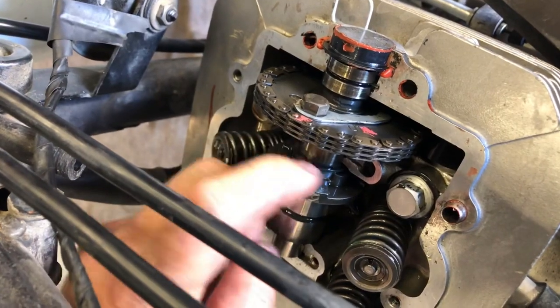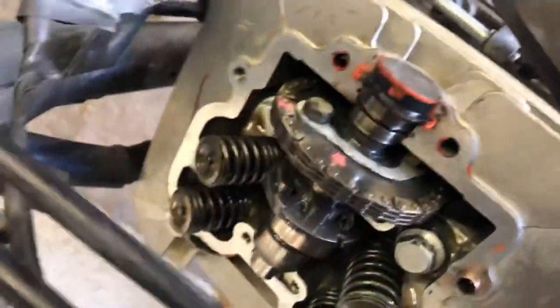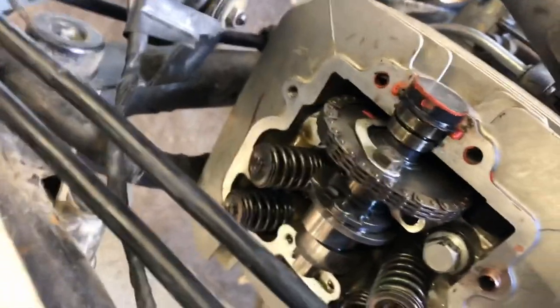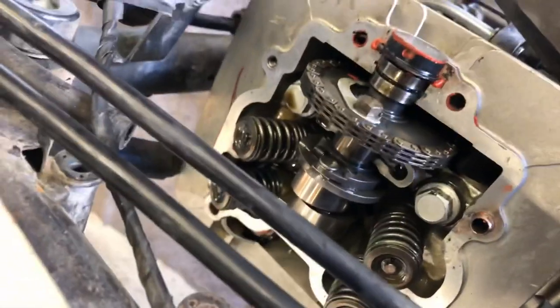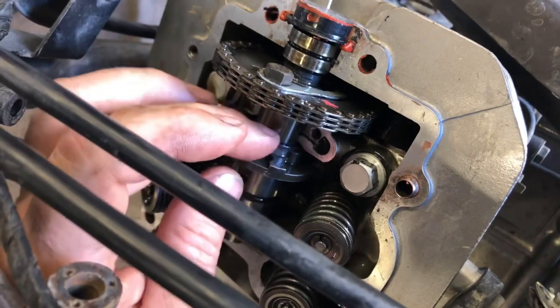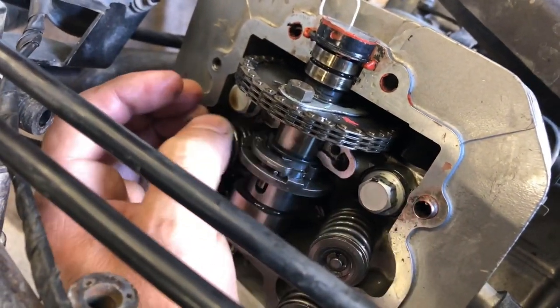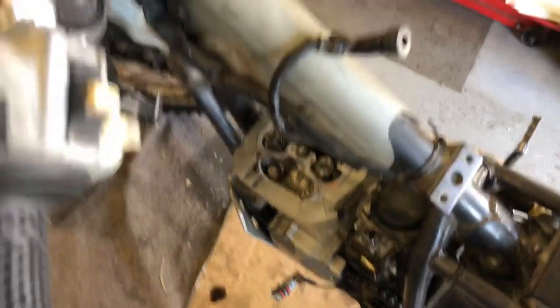The automatic decompressor — that thing feels like it's flopping around a lot more than it should. I think it should have a spring return on it. Let me see if we can take a look at that. This thing is hard to push over by hand. There's the spring — is the spring broken? Or maybe just the way it was sitting. That doesn't seem quite right. Something doesn't seem quite right with it — the way it's moving, it's kind of sticking. Well, this is our first suspect.